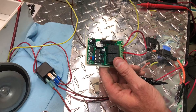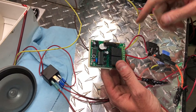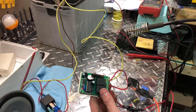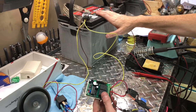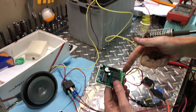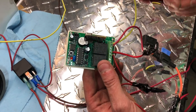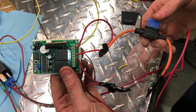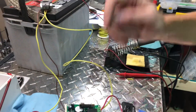We've done a pre-assembly to help speed the video along. I have wired it up — I do apologize for the funny wire coloring, we've been doing a lot of wiring lately. For ground we've used yellow. We've brought a battery right up on the bench to help demonstrate how this works. Our ground is giving our module power. This module will be placed under your dash somewhere, so you'll have to bring your connections to it. Right beside it is our power — we've added a fuse just in case — and that goes back to the battery, bringing power to the module.